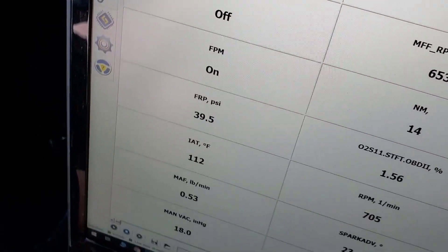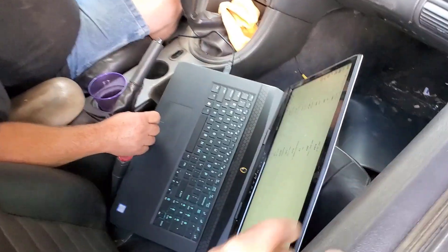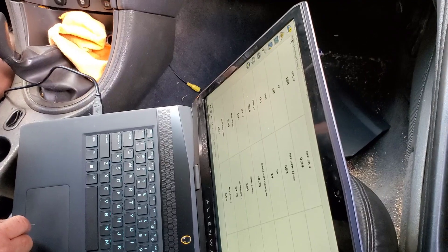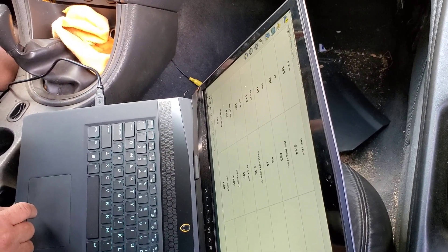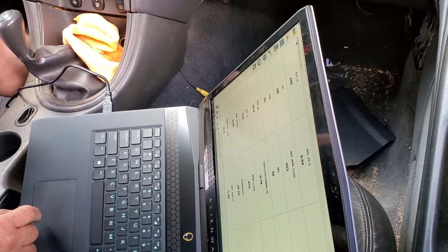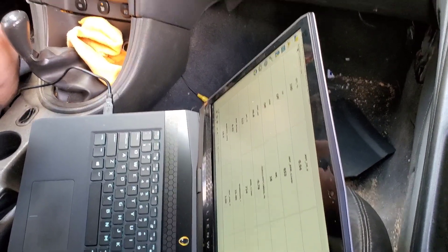But it's pulse width modulation. It still had that pump from my '96 in here that wasn't matched to it - the high pressure one, the racing one. I'm surprised it ever worked. But now we see it wasn't the pump that was messed up, it was that thing. We had that on here earlier and it actually started to act up - it dropped all the way down to like 20 psi, 10 psi. After you let it run a long time, then like 8. It started shaking and missing, the pump started making weird sounds, going super lean.